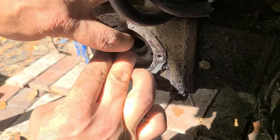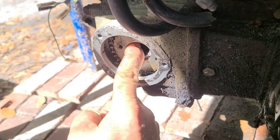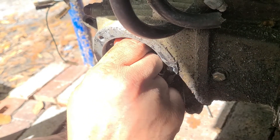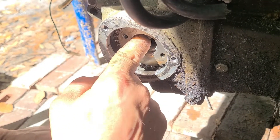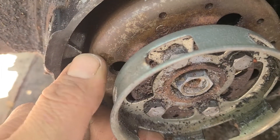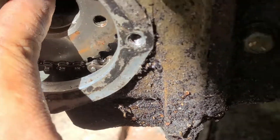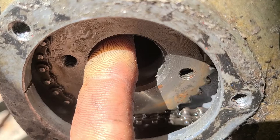Going to go down two. I'll spin that crankshaft real quick. Hold it. I'll get this thing set. Go backwards — a little more, a little more. Now put it back on the F. See the line for the F? We're going to get it lined directly up with this — the F will be slightly to the right. That's it. Now if you look, that little circle on the camshaft sprocket is now facing completely horizontal with this. I'd say that's right on the money.